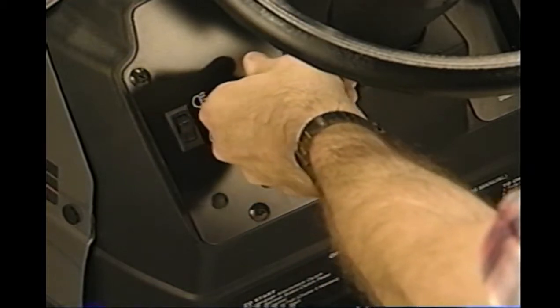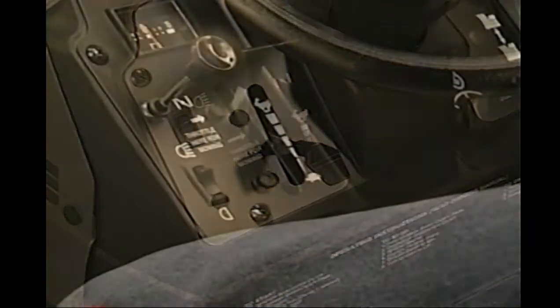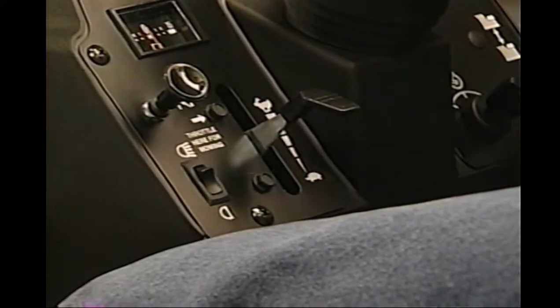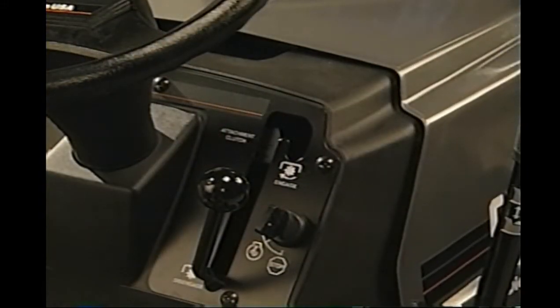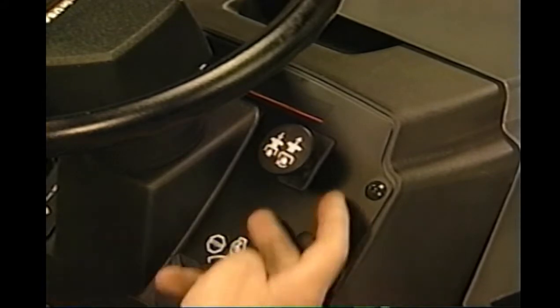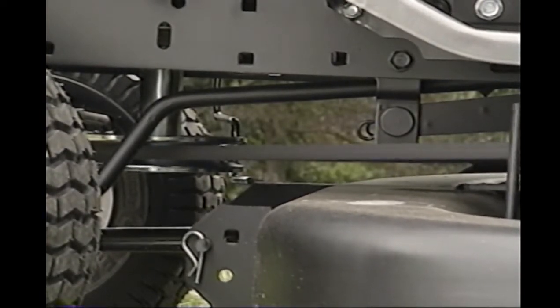This is part of normal engine function. Once the engine has started, move the choke control out of the choke position to about half speed. If you have a separate choke, push it in all the way and move the throttle to half speed. To engage the blades, move the attachment clutch lever on the dash up to the engaged position. On models with an electric clutch, pull the switch outward to engage the blade. You'll probably hear a small squeaking noise — this is the friction of the belts as they engage the blades. As the RPMs of the engine increase, the belts are designed to flop a small amount. There will also be some vibration when the engine is running slowly. These things are normal and there should be no cause for concern.